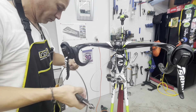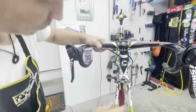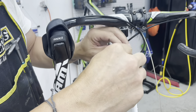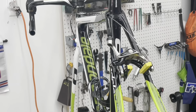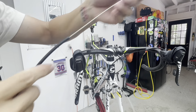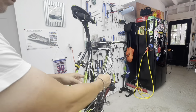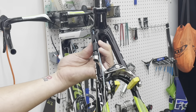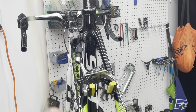Cable routing is a personal preference. Everyone has their preferred method — I'm not too particular, but I like not having too much contact, so I went with the parallel under, and these bars have a little channel for that. The newer aero cockpits have much more. I told you earlier I left that rear brake internal cable in there, and now I'm using a piece of PVC tubing to create a little pull cord so I can route the new cable through. There's a link below in the description for tips and tricks. You attach the PVC to the new cable and slowly pull it through. Chasing that cable down after you've pulled it out can be a nightmare, so always have something to guide it back.